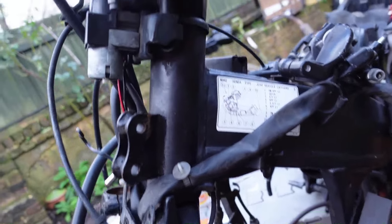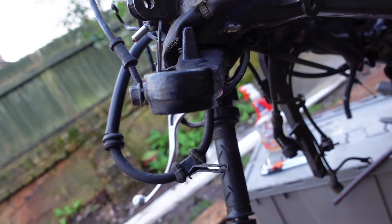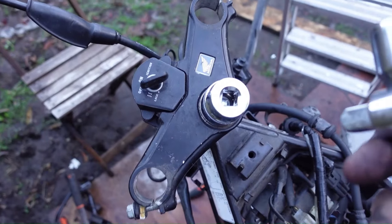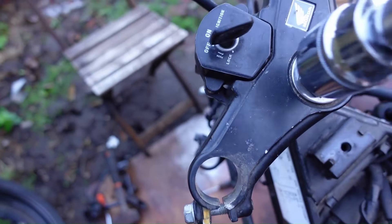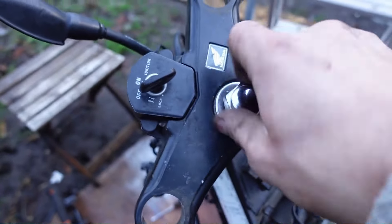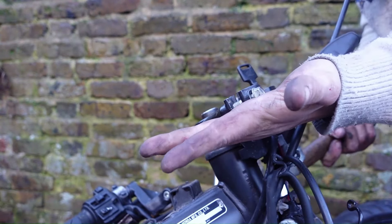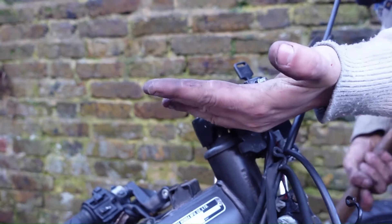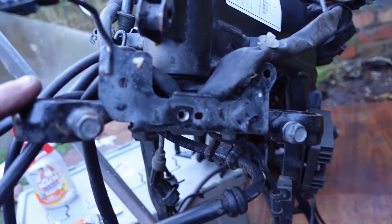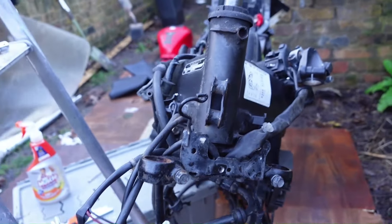Logic tells you that this yoke should be bent, and of course it is. You can just see that this lower yoke is well out of line from the top one, so I'm going to have to change the whole thing. To take the top yoke off I put my 30mm socket in there and give it a twist — it's actually very loose. Push up with one side, tap the other side, and that's done. To take out the bottom yoke you have to take this plate off first — just some 10mm bolts under there. I'm going to remove the bottom yoke off camera.